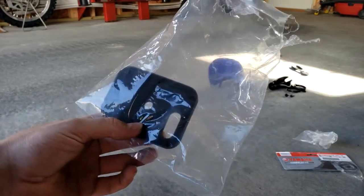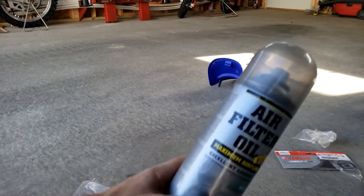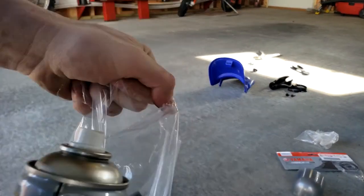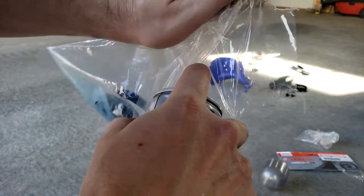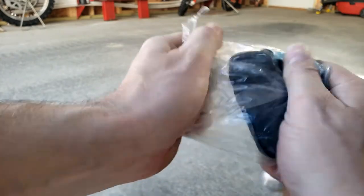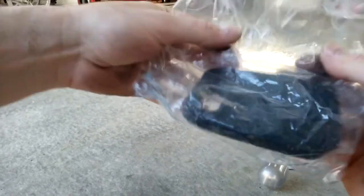One of the things we're going to do here is put the air filter oil onto the filter before we install it. The brand I like to go with is Motorex — they usually have the best stuff. I'll use the same bag that the filter came in, spray right in there to get a nice adhesion. It helps with keeping out dust particles so they don't fly through your motor — it's kind of like a sticky collector.